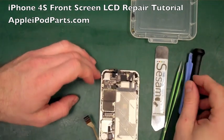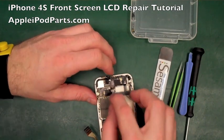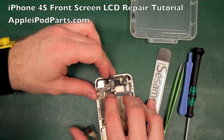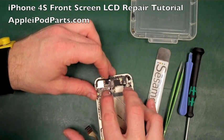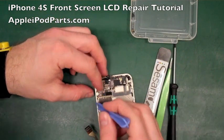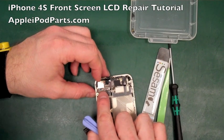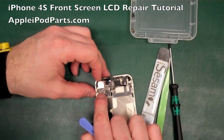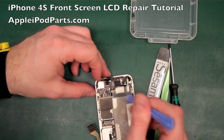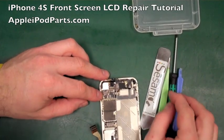Put that screw in there, and we start with all these connectors. Chances are all these connectors find their own home now, because they've been sat there and they're all bent to shape. So it's a case of putting one connector at a time. Then I tend to use the back of a plastic tool just to push the connector home and gently rub it, because you don't want them pinging back up. So you use your finger to find the connector, push it down and make it click, and then just run over it like that. There we go. So you're putting those set of connectors back in.